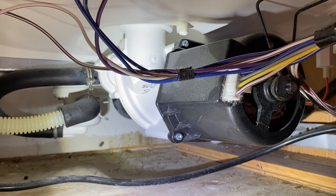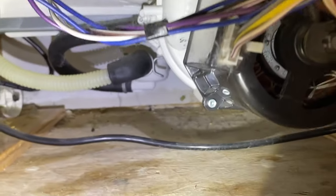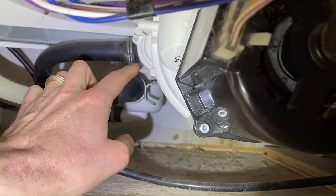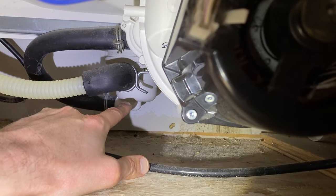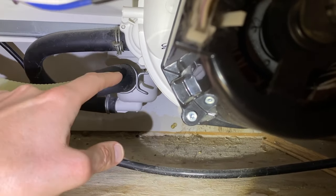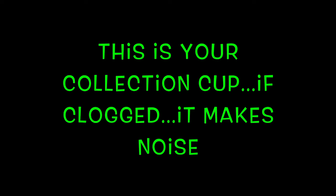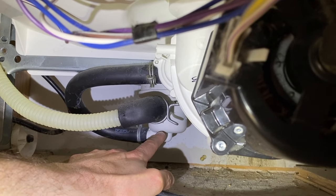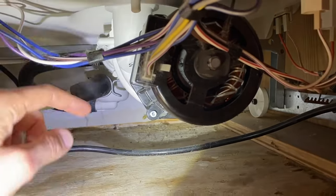In the event that you want step-by-step guidance on how to do that, definitely check out the link scrolling above. Next common cause — let's go all the way back to our drain hose right here. Feeding off the actual housing that we just talked about is a hose that loops around, goes through this back part here, and then feeds the water through and out of your drain hose, exiting your entire dishwasher system. The grinding noise inside this part will be very quiet, nowhere near the grinding of a motor bearing going out. So pay attention to that as well.